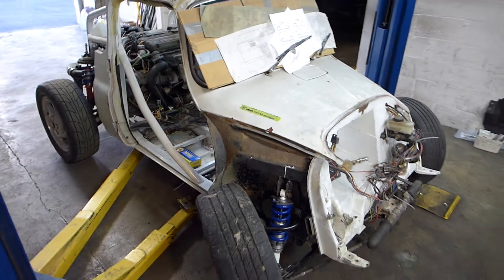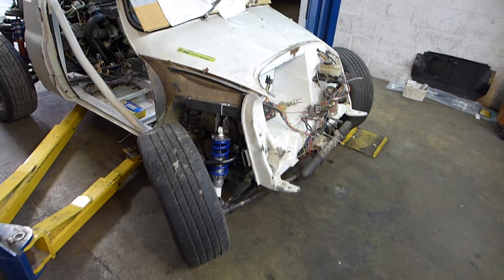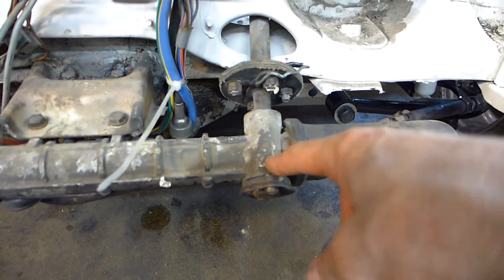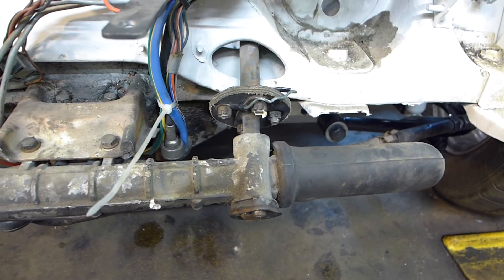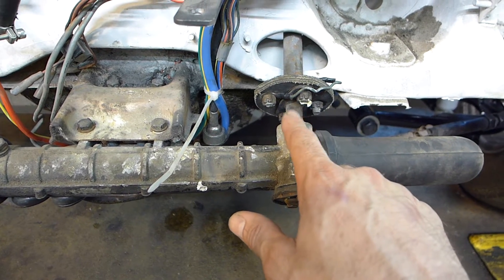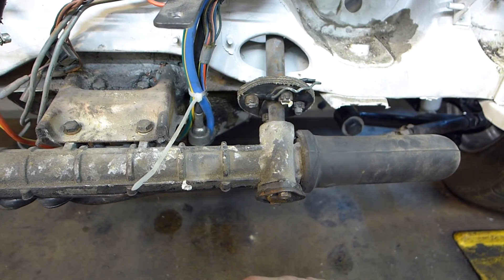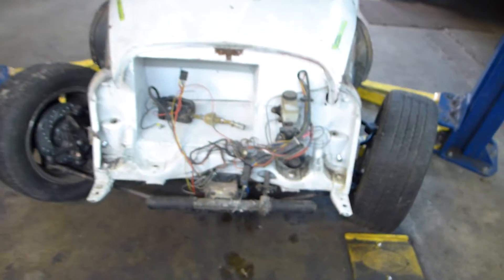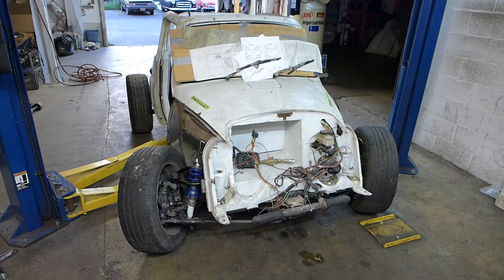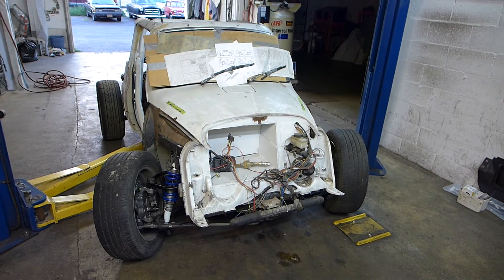So that's where we are tonight. I'm working on ironing out all the little bugs. I've got to make a new lower crossmember, adjust those control arms down, and find a rack. I might go with a Mustang 2 rack, which has the input on the bottom and turns the wheels the opposite way — which is what I want — but that's going to require a whole bunch of fabrication. I may figure out a way to gear this like an oil pump, where the center turns one way and the outside turns the other way, like a planetary gear. Just wanted to give everybody a status report on the 4G63 Monster Subaru 360 — it hasn't fallen by the wayside, but it is making my hair turn a little gray. Thanks for watching, subscribing, liking, and commenting. Have a great day!